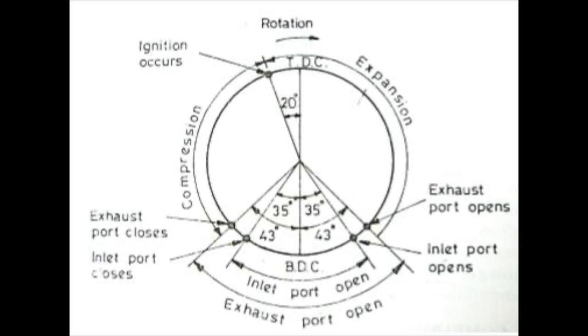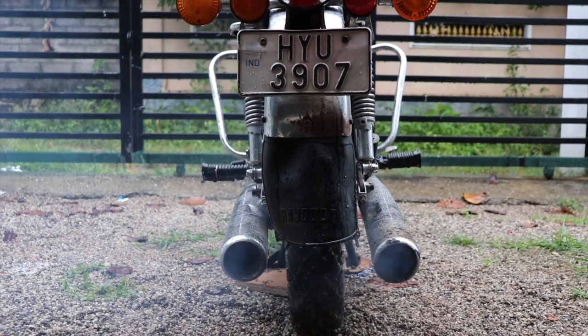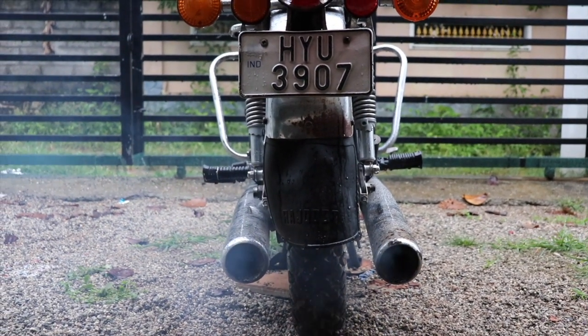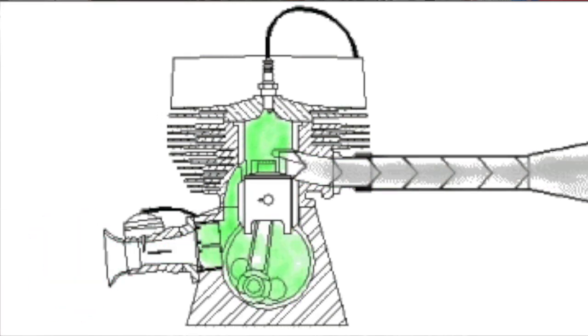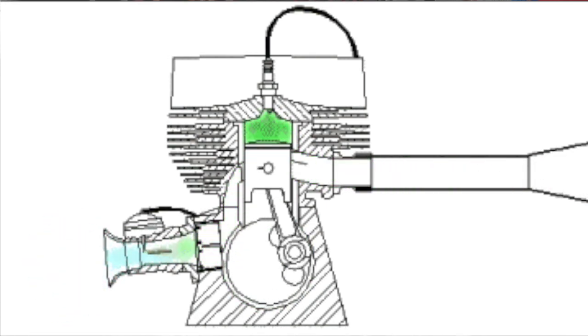From the image on the screen you can understand that the crank is turning clockwise. We will start at the bottom dead center. You can see that both the inlet and exhaust ports are open. When the crank rotates 35 degrees, the inlet port closes. The air-fuel mixture fills the crankcase at this stage due to the low pressure created inside it. Unlike the four-stroke, the combustion chamber is a sealed unit and has no engine oil for lubrication. This is the reason 2T oil is mixed along with the fuel to lubricate the crank and the cylinder walls. When the intake port is closed, there is positive pressure inside the cylinder and negative pressure in the exhaust, leading to a phenomenon called scavenging where burnt gases escape the combustion chamber.